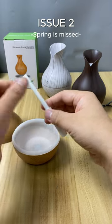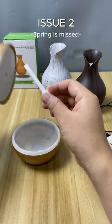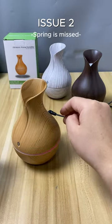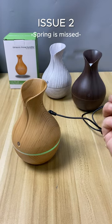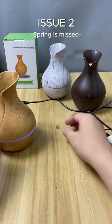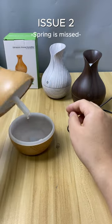Remove the tube and then the cotton filter. Then reinstall the cotton filter and the tube. Please note that at this point there is no spring inside the tube — no mist comes out. The reason lies in the importance of the spring: it is a crucial component that supports full contact between the cotton filter and the ultrasonic atomizer.